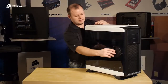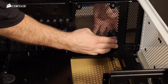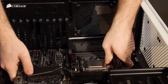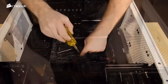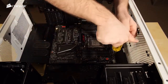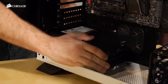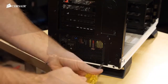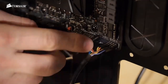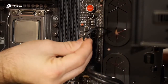First I'm going to take off the side panels so they don't get in the way while we're doing the build. First we need to insert the rear I/O shield. Next we can align the motherboard with the I/O shield and get it ready to screw it in. Next I like to get the power supply installed. It's a good idea to get your front I/O panel cables plugged in before you get too much hardware in there. And while we're at it we'll plug in the two front intake fans into the motherboard.